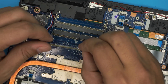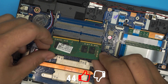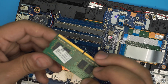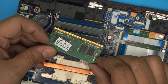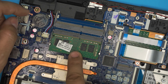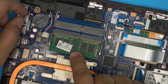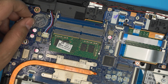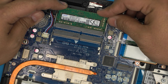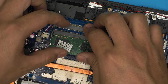This is a DDR4 RAM — this one is 8 gig, so you can grab another 8 gig and place it in here. Make sure the notch on the RAM matches the notch on the DIMM slot — it can only go in one way, so if you try to put it in the other way it simply won't go. It doesn't matter which side the RAM chips are on. Bring it in at a 45-degree angle, push it all the way towards the DIMM, then push it down towards the motherboard — you should hear two clicks. Install the second DIMM the same way. I'll leave compatible RAM links in the description.